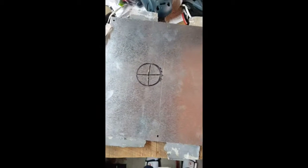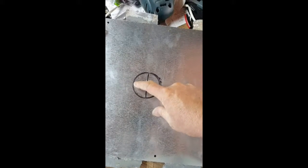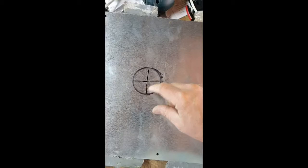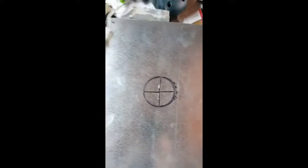As you can see, I've cut out my pilot hole with the Dremel tool — honestly, I don't know what I'd do without this tool, it's one of my favorites. Now I'm going to cut across here because it doesn't do really tight circular cuts well, so I'll cut across and do less work with the tin snips to make it as round as possible. Here we have the finished hole. I took the deburring edge on my Dremel and ran it across the entire piece to eliminate sharp edges, because we certainly don't want anything impeding the liner or the seal.